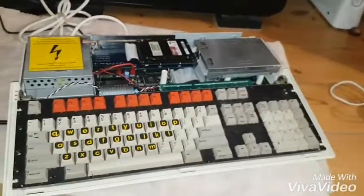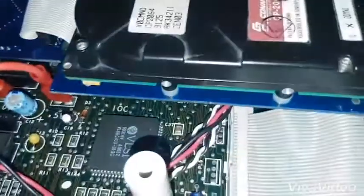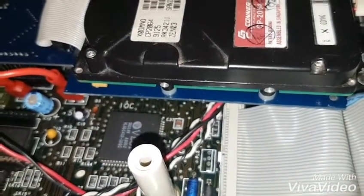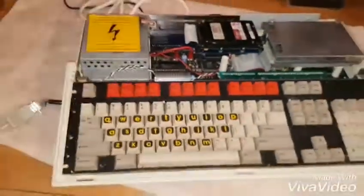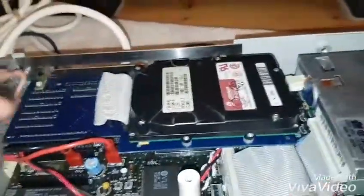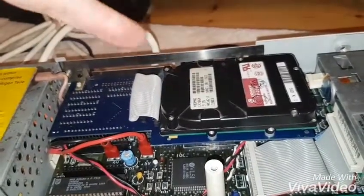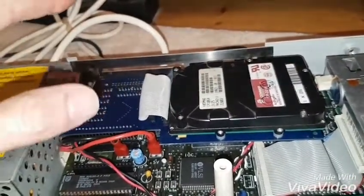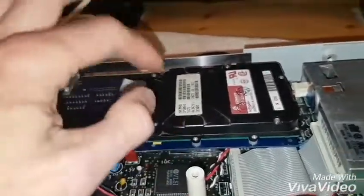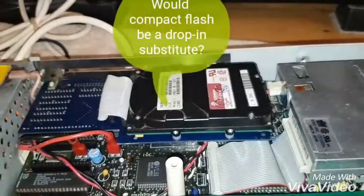I didn't have a mouse to get this going, and there are a couple of problems. The disc drive keeps spinning up and doing nothing. So I took the disc drive apart and off — this is an IDE board. It's got a ROM on there and an IDE chip. I reseated that, reflowed all the solder joints, took the drive off, tapped it sharply — just sharply enough to release anything that might have been seized up. Made no difference.